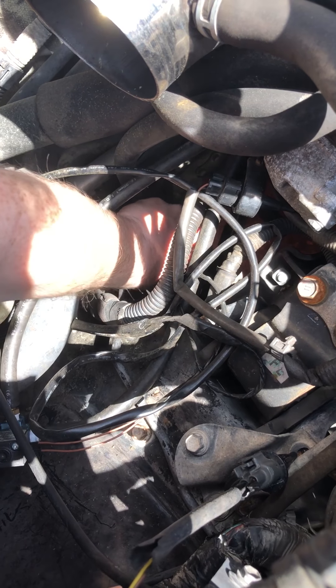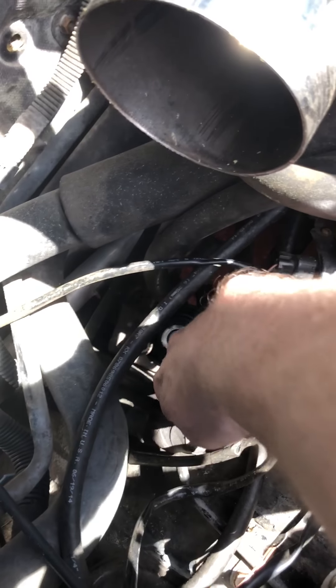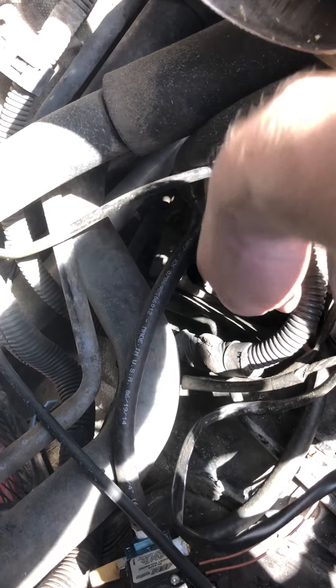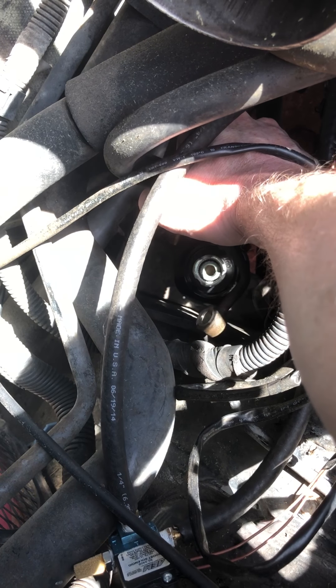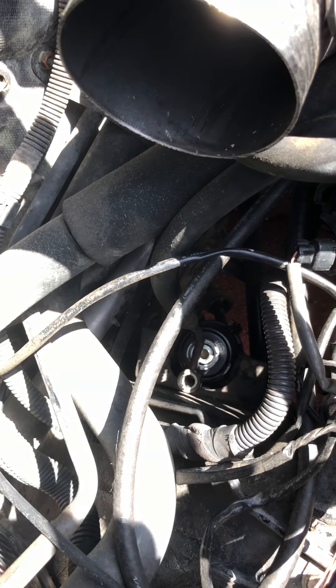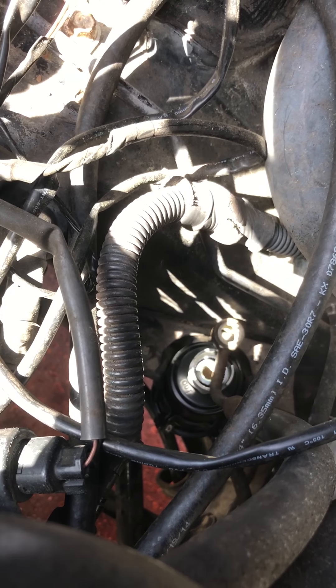So it's basically going to give you a little bit of tips on how to do it. Here's your intake — the fuel filter's going to be right down here, you can kind of see it. You're going to have a 17 millimeter bolt on the top, looks like this guy right here. It's going to have a washer on the top, should come with the new filter. The same exact bolt is on the bottom — 17 millimeter also — and you have a 10 millimeter bolt that holds it in there in a little bracket.